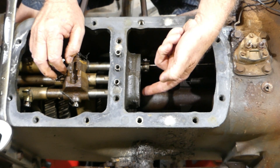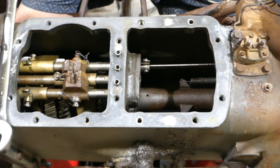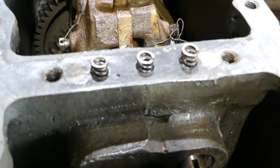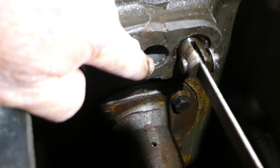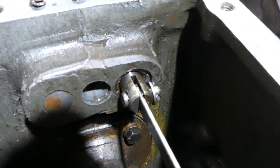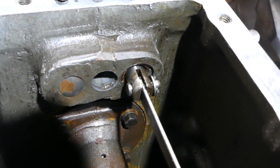On mine there's a Welsh plug there still, and there's one here that's missing. I'll just go handheld for a minute and bring you in on an angle so you can see. There's the view from the front — that's your gearbox, looking down into your box. There's your springs. I have a Welsh plug in here still, but the Welsh plug from here is missing. With the gearbox running along, that's certainly a way of oil getting into your bell housing. On this shaft up the back there's a lip seal. If we do a clutch later, you'll get an opportunity to look at that as well.